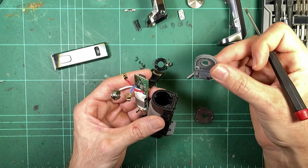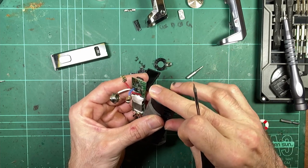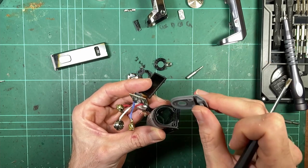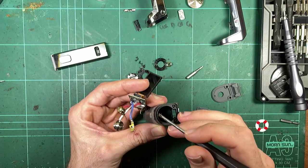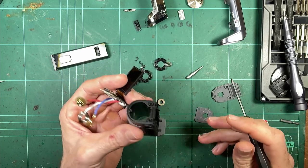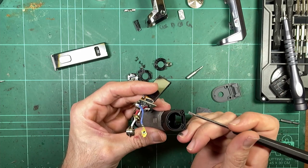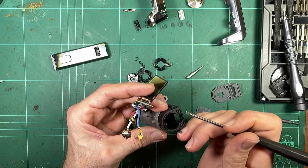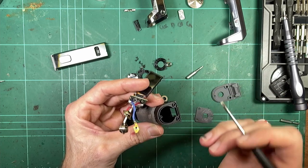It's relying completely on this silicon piece to seal it up. No liquid sealants or anything. And the other problem is these screws potentially pulling out. Well, I reckon probably likely to pull out. If you drop this mod onto the tank, has a decent hit onto the tank, I would not be surprised at all if these three screws start to pull out or even crack that plastic.